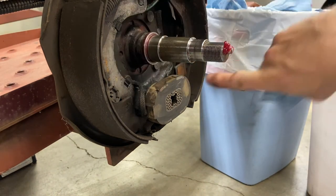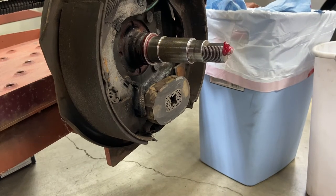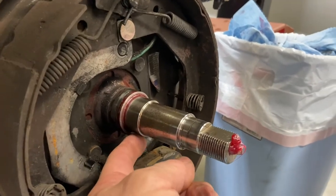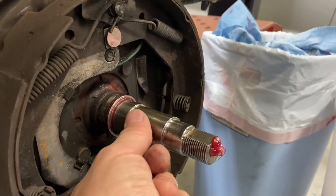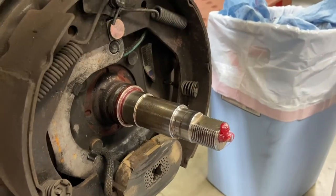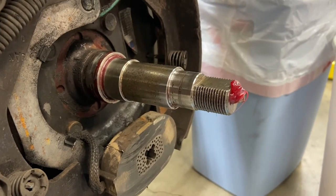Be careful not to get any onto the pad here, the electric brake pad. All right, I don't really know for sure, but since the grease is coming out near the inner bearing, I'm sure that the grease works its way all the way out and into the front. So maybe it does re-grease both bearings. If you know for sure, leave a comment.